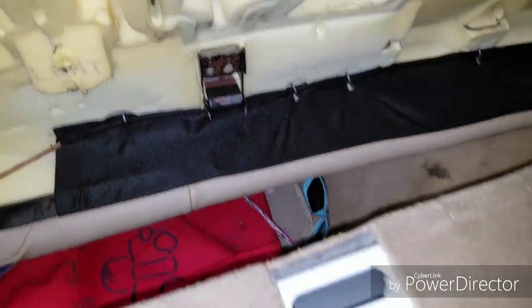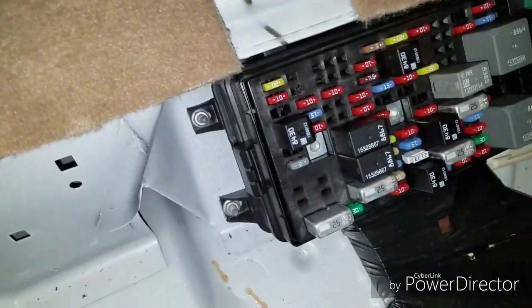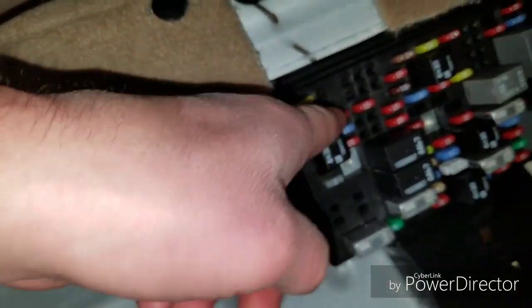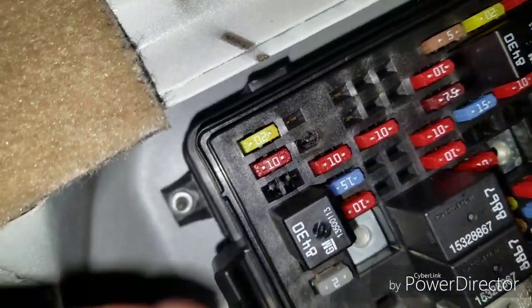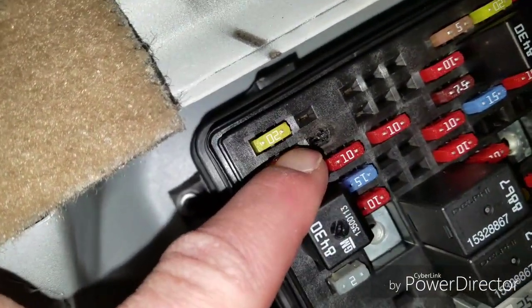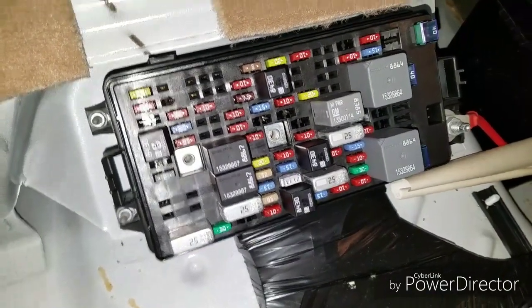The clip rubs on the top of the box, which wiggles it and messes with the relay. So the relay ends up arcing and burning out. It burns out the relay, it burns out the hole. So I had to replace the whole fuse box, not the fuel pump.